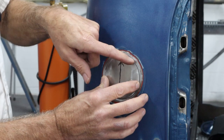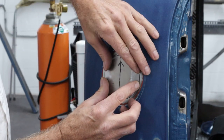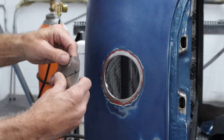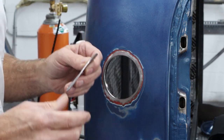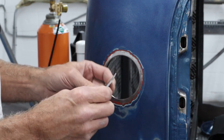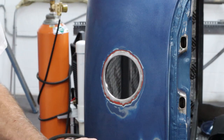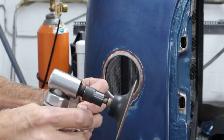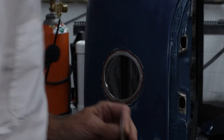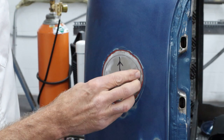I'm going to get this to fit down inside the hole, then take the profile gauge with a magnet holding the panel up, and slide it over the top to see how it looks. That feels pretty good. The way they punched this out, the lip goes in at a little bit of an angle, so I'm going to grind a little bevel all the way around this so it sits inside there real nice. Just that little bit of taper made all the difference right there.